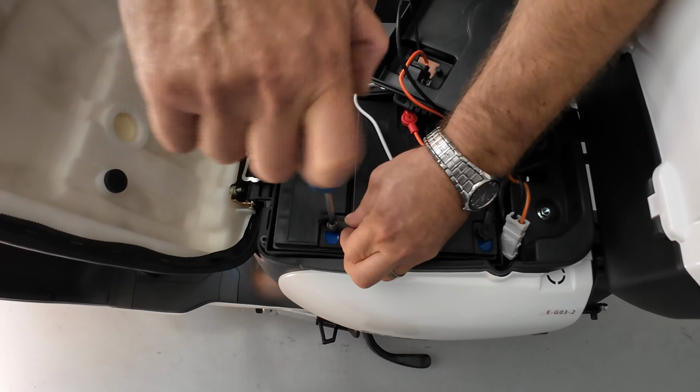Now, and the last, you remember when I was showing you how to test your batteries right here. Maybe it's going to be more clear for you. Now we see the display, which is saying almost 64 volts. That's how it's supposed to be. Now you might think that if you unplug it here, you're going to have the same voltage. You are not going to see any voltage here from this battery pack because it's connected in series with this battery. But you're supposed to see voltage at this plug, and if your lower battery pack is good, you're supposed to see at least 25 volts, and that's what we have. You will not see any voltage here because it's not in series, but only with the lower battery pack.